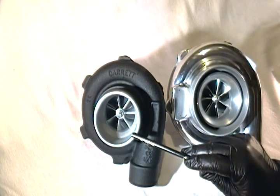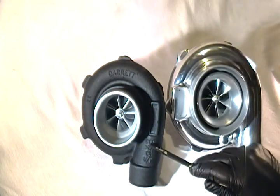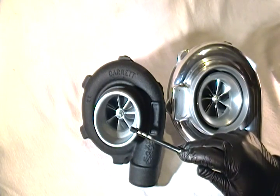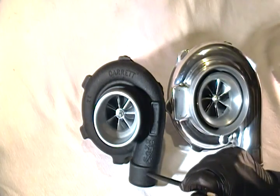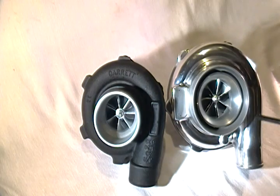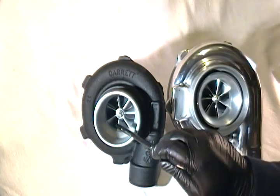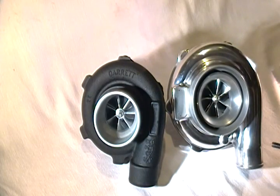The Banshee is a slightly smaller package, using the same T04B package as the Silver Surfer and Hunter, with a standard 2.75-inch compressor inlet and 2-inch outlet. The similarities in the compressor wheel include a 7 splitter blade design using a very large exducer and extended tip for both designs, allowing for more air ingestion, transient response, and good torque — but not as aggressive an initial bite as a slightly smaller turbocharger.